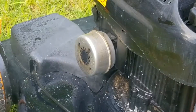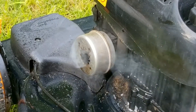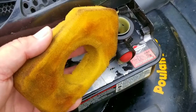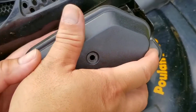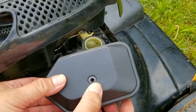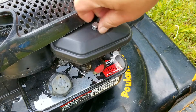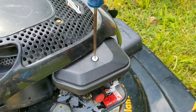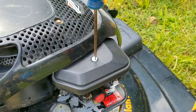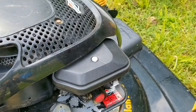As the engine got hotter, the oil that was in the muffler started to burn off and the smoke had a very familiar smell — it smelled a lot like the exhaust from a bus or a semi truck. If you hadn't figured it out already, someone put diesel fuel into the gas tank and that's the reason why it wouldn't start. What looked like oil coming out of the muffler was actually diesel cleaning the carbon from the engine and collecting in the muffler because it wasn't burning inside the engine. I've never seen this happen before, but just like the wrong spark plug, mistakes do happen.